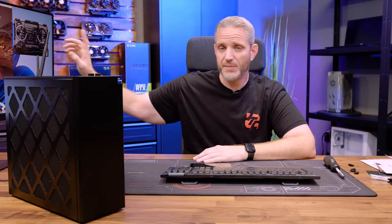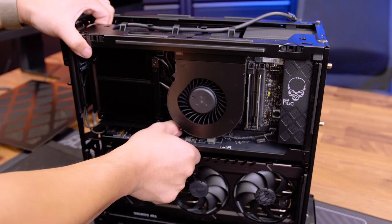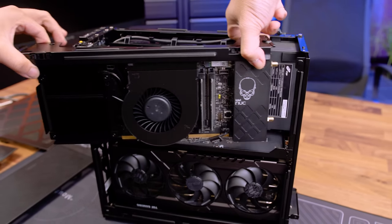I'm shocked at how well the GPU is actually performing in here. Even after speeding that fan up to 65%, it only came down one degree on the GPU. That tells me the overall cooling capacity of this chassis with all the ventilation is enough for the GPU, which is typically not the case for small form factors. Because of the top-bottom compartment design, all that air flows in from the front and the rear exhaust fan grabs it and pulls it out. If you put your hand on the back side, a lot of heat is coming out — so you need to consider which side you place it on. Fortunately, there's no right or left to this system; it's ambidextrous.